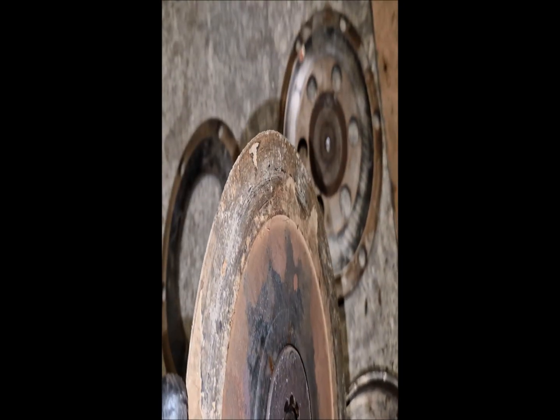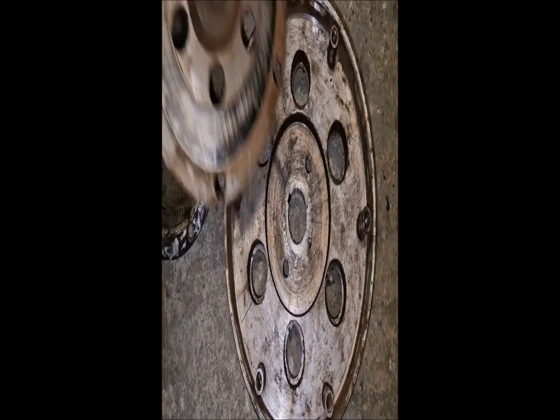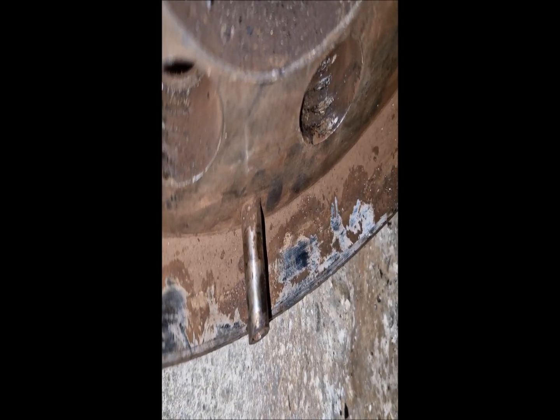The clutch discs are okay, but what is not good is — you can see these holes are a little worn. That means poor material, or maybe this engine was abused. It can be used with no problem, but it is possible that when the engine is idling there will be a little rattle and noise. Also, we can see these bolts are a little worn out, and I am thinking to change them.